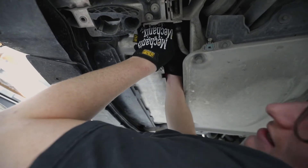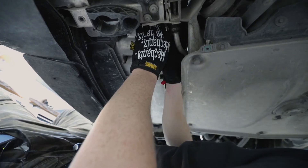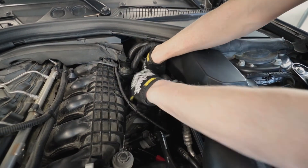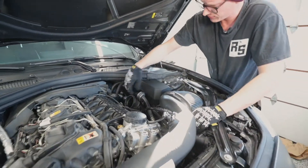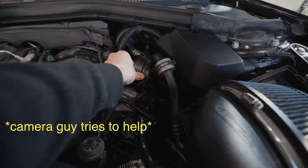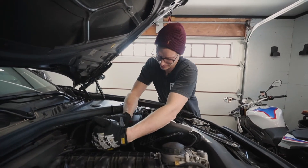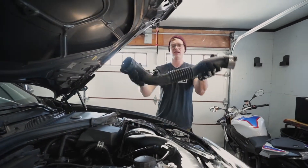It's a little tight to get your hands in there, especially with the aftermarket intercooler. Twist it right off, push it loose from the bottom, then go up top and pull it out. Now that it's off both the bottom and the top, everything should be removed — it's just a matter of finessing it out of the spot with a little rotation. If you have a second person to help push from the bottom, that will definitely help. This is why the aftermarket charge pipe comes in two pieces. With some twisting back and forth, voila — she's out.